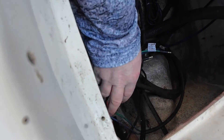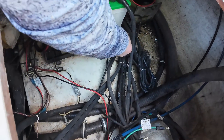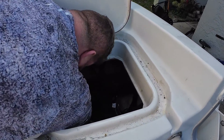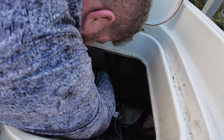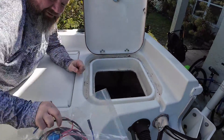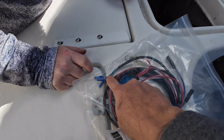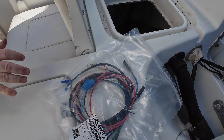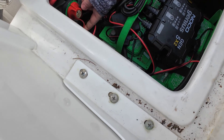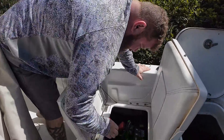I've got some more wires. Those cables go straight to the battery — the positive and the red. Actually, I believe they go through the power switch when you turn it on. So you're going to have to trace them all the way to the switch. You can use the existing wires up until here and then reconnect them into the new module. I believe this one here is the positive — I just have to retrace it. It goes to the battery switch, not the dashboard switch. That's not too bad at all.